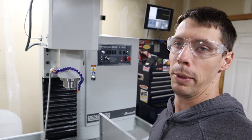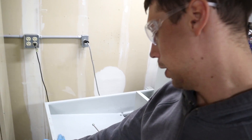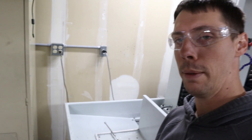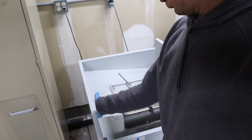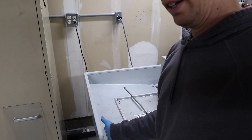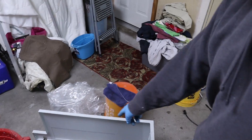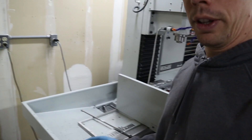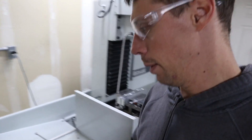With all those off, I'm just going to wipe down the edges and make sure they're all grease-free. Then the idea is to take the angle iron and put it right along here with one end flat and the other edge on the inside lip. That way I'll have a border with a nice inside lip flush with the inside lip on the pan. When I run sheet metal, I can run it past a little bit, just like how the factory splash shields have that lip on the very bottom, and that should help all the coolant drain down past the seam instead of leaking through it. That's the plan for the bottom.